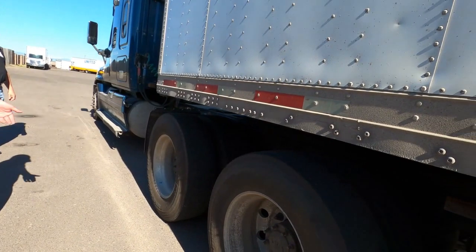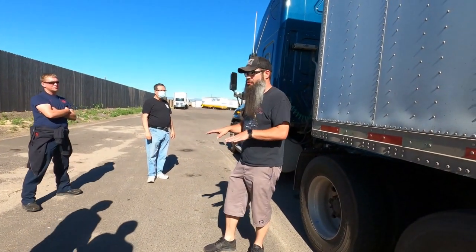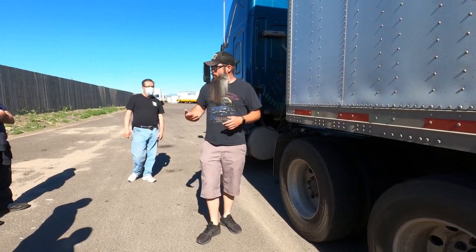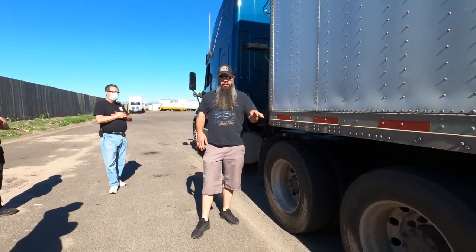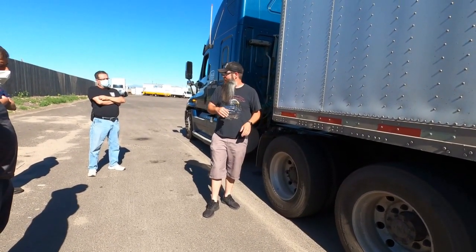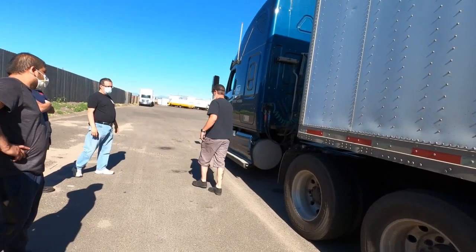So what we're gonna do now is we're gonna go ahead and get in the truck. We're gonna start it, and then I'm gonna pull forward, okay? When I pull forward, I'm waiting for the trailer to feel it drop. Remember, because we have it, it's gonna slide off the skid plate. Once the trailer drops, I'm gonna pull forward about a foot, and then I'm gonna wait, and I'm gonna look in my mirror, and if you want, you can set the brakes and get out and inspect to make sure that the trailer will stay, okay? If the trailer starts moving, or if the landing gear is broken, the trailer could fall, and if I'm pulled forward a little bit and I stop, then what'll happen is it'll fall down on the frame of the trailer, and I can still get back underneath of it. You never just wanna pull all away right and fast and everything like that. Make sense? Cool. Okay, so that's what I'm gonna do right now.